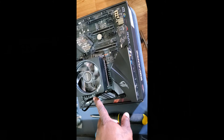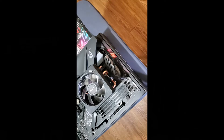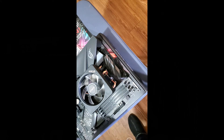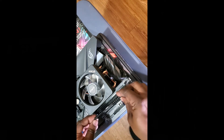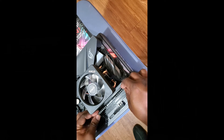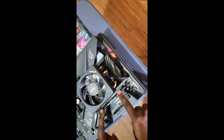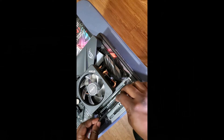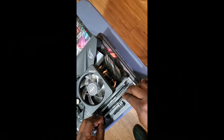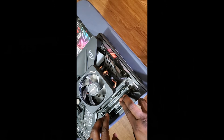I was a little skeptical about this side over here but everything is good to go. Now it's time to install the RAM. My motherboard is telling me to install it in the A2 and B2 slots, so I'm going to go ahead and install this. All right, it's telling me to install it like this. There it is.